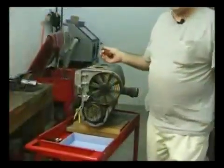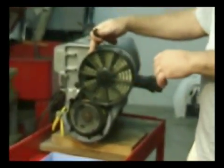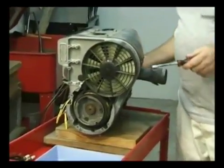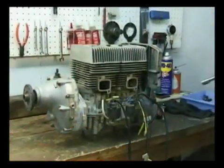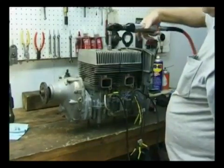A lot of people make a big deal out of how to get this thing off — it's really very simple. There are three clips on it, and I'm going to tilt the engine to show you one of them. My air tool is going to get going here — I'm just going to pull the head bolts off. There are four in each head.